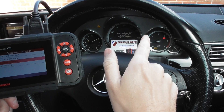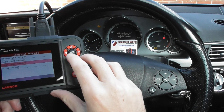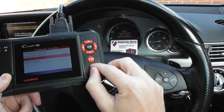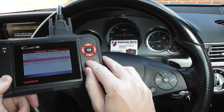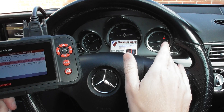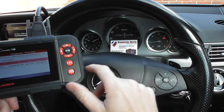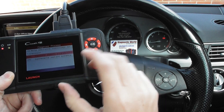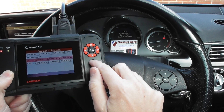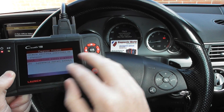All of the lights are still on at first — what you need to do is come out of the ABS system on the diagnostic tool. So I click Escape, and keep an eye on the warning lights... there you go, they've all gone off, apart from the brake light because we have the parking brake applied — that's why that happens.